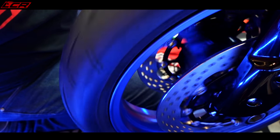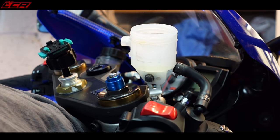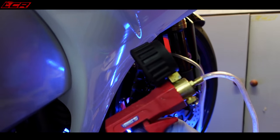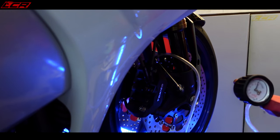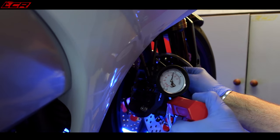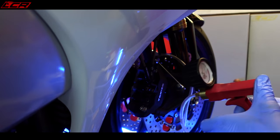There's no binding of the band or anything — the wheel is now spinning beautifully free. Now all we have to do is re-bleed the brakes. It's actually gone quite well so far. I have my vacuum pump connected and now I'm just going to pump away. Open the valve. I can see something happening already.